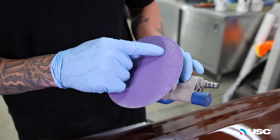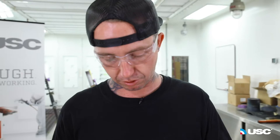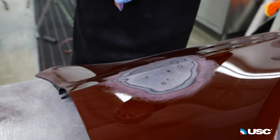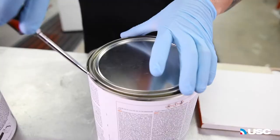You can see how much of the grit is actually still there — and I just sanded this down to the metal. You can see that, and you can feel it as well; it's barely even used, it feels almost brand new. So what we're going to do now is just feather this back with a higher grit, probably 180, and then we're going to start applying our filler.